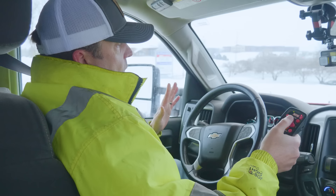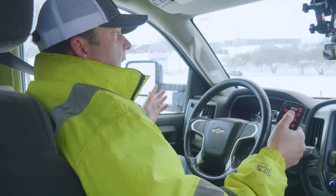So you're driving down in float — really not doing anything with my plow at all, just leaving it, monitoring. I come to the end. Once I'm at the end, I'm going to pick that up a little bit — just if there was a curb — and then keep raising and pushing it. You also want to make sure you keep pushing that snow forward. If you just leave that pile right there at the end, the truck can only push snow so far. So you want to make sure you keep pushing it to wherever it needs to be and then work your way backwards.